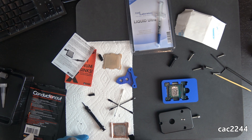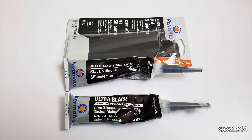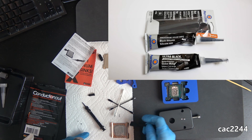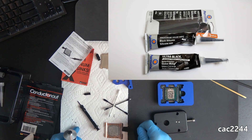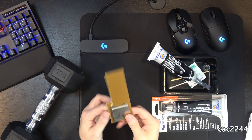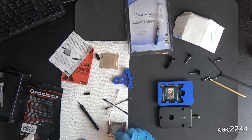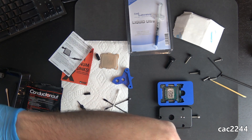Once this is all done, we're ready to clamp everything back together, and we only need to use adhesive on the bottom four legs of the IHS — just a thin, smooth layer. On YouTube there are two camps: one says to use black automotive silicone adhesive like Permatex Black RTV, and the other says to use Permatex Ultra Black gasket maker because it's sensor-safe and friendlier for electronics. I tested both with scrap copper boards and found the silicone adhesive was much sturdier, so I went with it. Both products handle high temperatures, which is what you're looking for.